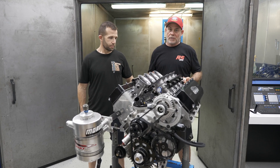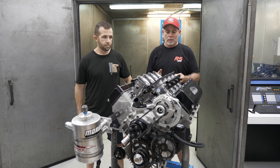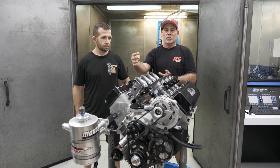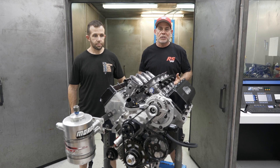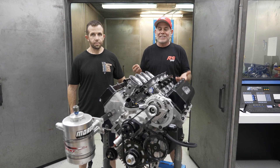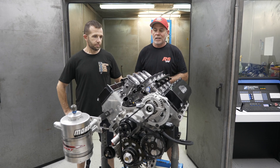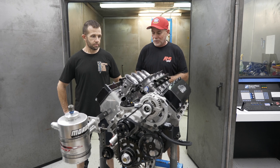Pretty impressive engine — everything worked really well. The stacks are going to offer good drivability down low because there's not this big cross plenum chatter. The noise you hear in the exhaust system from the camshaft — the boobity-boobity-boobity — that's happening in the intake too, which makes them drive bad down low. But this thing's going to drive nice down low and we'll have good power management because we can just control the throttle angle with the Motec.